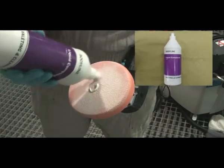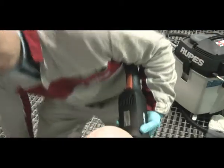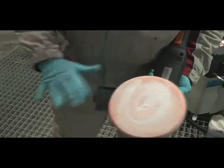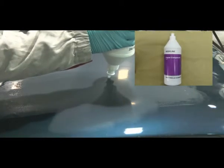With the Bodyline orange sponge head, apply Bodyline liquid compound to the orange head and work it into the sponge. The orange sponge head is now loaded with Bodyline liquid compound. Apply Bodyline liquid compound to the panel, about a pea to a bean in size in amount. With the polishing machine, work the liquid compound into the panel without the polishing machine running.